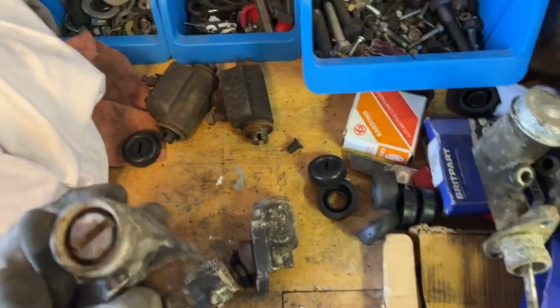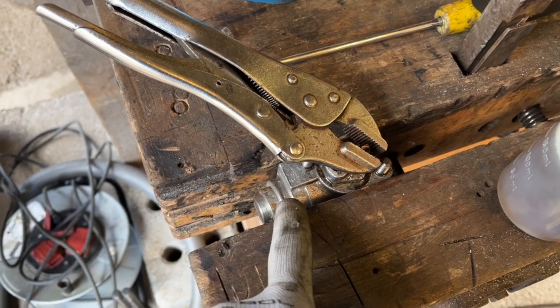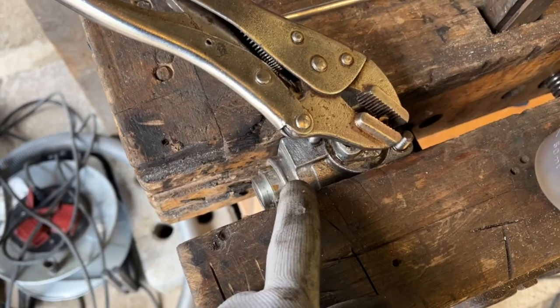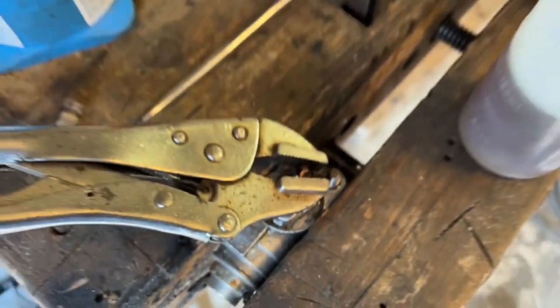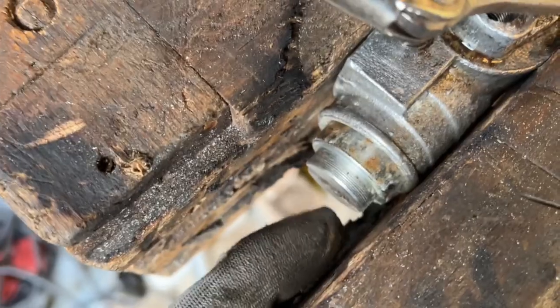So, you remember my stash of brake parts and Girling stuff from the UK last year? Well, I just unpacked all of that. I've got the Girling wheel cylinder and it is actually the one that I need. So I'm taking it apart now just to see if I can save it. I've had to heat things up because these nipples were really well embedded in there, but they're actually coming out with a bit of heat. And also the piston popped out, so I'll show you that in a minute.